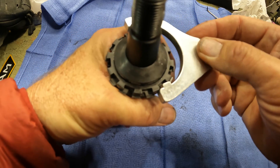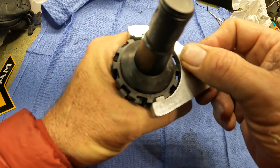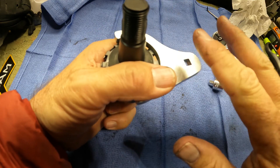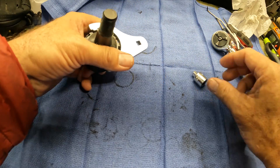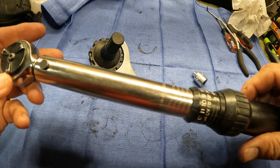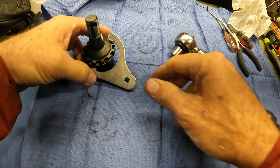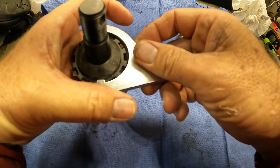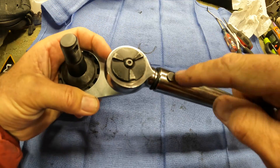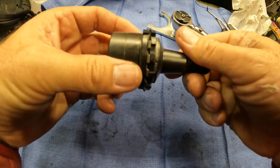You can't really index it well if you're one off, so you have to be pretty much opposite of each other. I just snugged it down by hand, because this is only 10 foot pounds — 120 inch pounds. I don't have a quarter-inch drive torque wrench; that's a quarter-inch hole. This is a 3/8 drive torque wrench but it does do inch pounds. So I have it set to 120 inch pounds with a little adapter. The instructions show pictures of how you should align your torque wrench — it needs to be in line with your wrench. Then you just torque it down to spec, and your ball joint is preloaded appropriately.